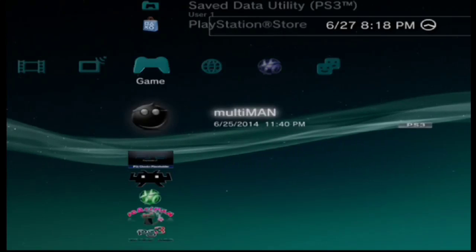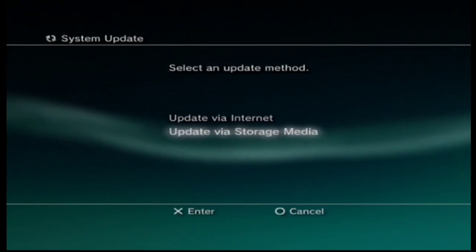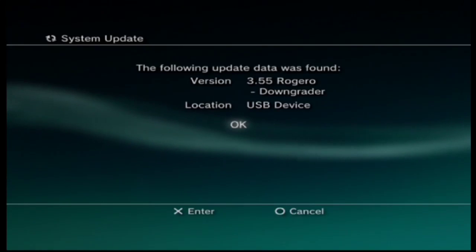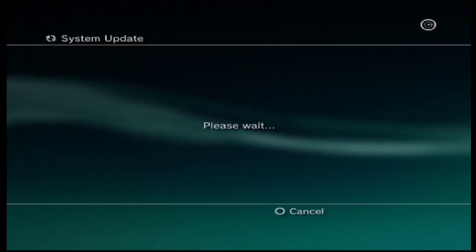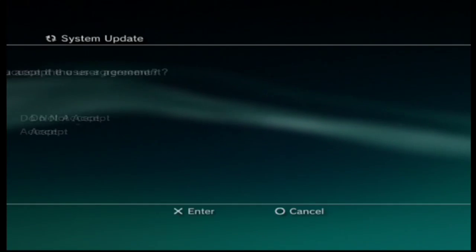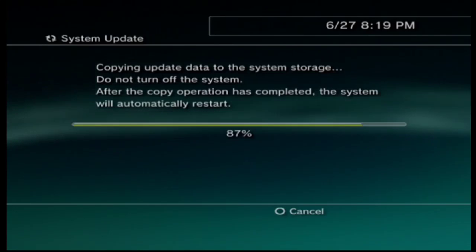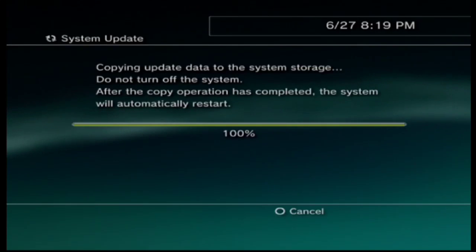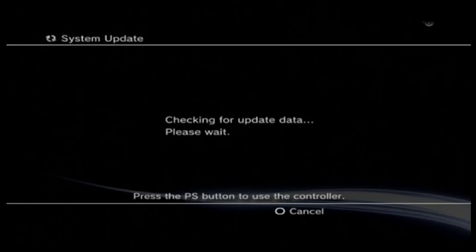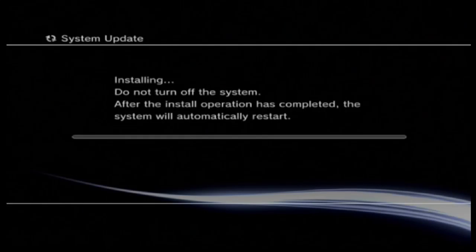He disabled the ECDSA in level 0 loaders. Disabled ECDSA and SPU package. No function for CFWs enabled, so no homebrew is going to work, no backups are going to work. No QA flag enabled, so if the QA flag was enabled, as I just demonstrated, it will no longer be enabled for the time being until you get it downgraded back to some other QA compatible firmware.